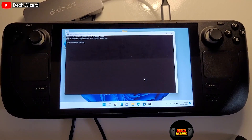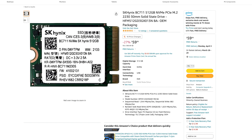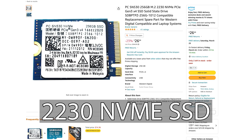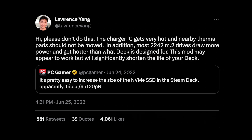Here's everything you will need before you upgrade the SSD on your Steam Deck. First, you'll obviously need an SSD. There's a little variation in speeds, so I'll drop a link to some of my favorites in the description that are compatible. But if you are buying your own SSD, just make sure it is 100% a 2230 NVMe SSD. There are some other-sized SSDs that will technically fit in the Steam Deck, but Valve has said don't use them because they will probably overheat your device. It has to be a 2230 NVMe SSD. As long as it is that variant, you can pick any storage capacity you desire.